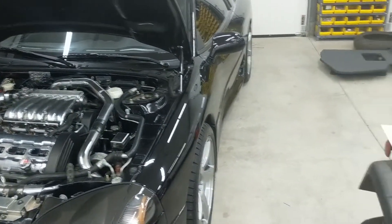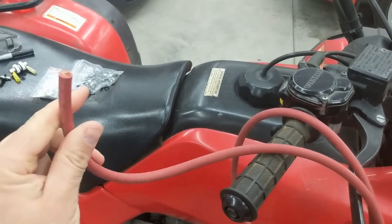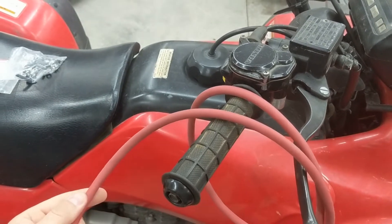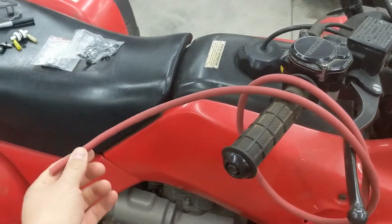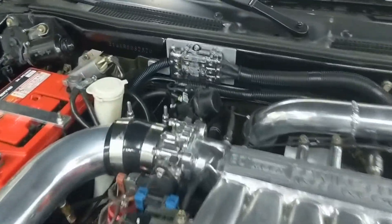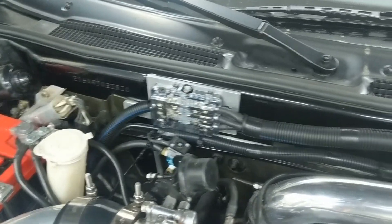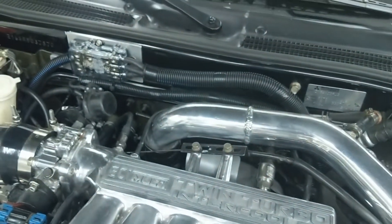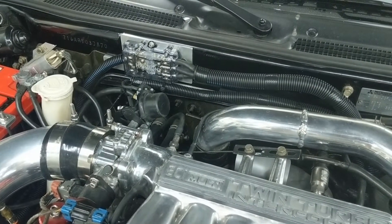The only thing I don't like about this wire is the color — it's a flat red, not a deep bright red like audio cable usually is, so I try to hide it. I've added some heat shrink to it so it looks black, but underneath it's that same pale red. The wire loom with the blue line on it is high-heat wire loom I got online — it can handle temperatures a lot hotter than the normal stuff you'd buy locally.